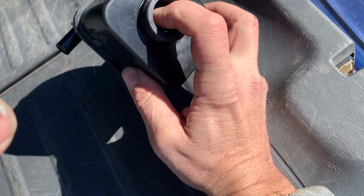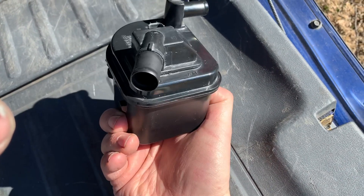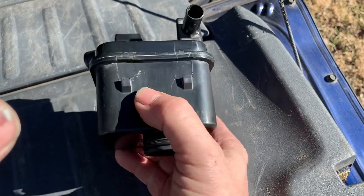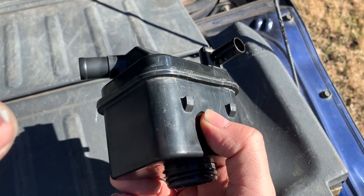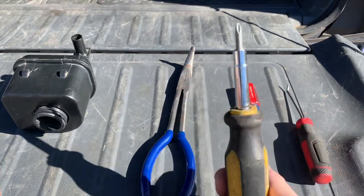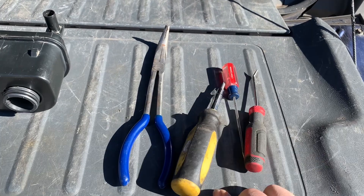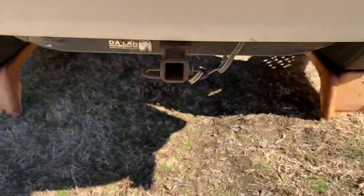Here's what the evap valve looks like — that is the actual valve that should open and close. There's the electrical connection, there's a hose, there's a hose. It hooks into a charcoal canister underneath the car; it's part of your emissions control system. You don't have to pull the entire charcoal canister to replace this. Here's everything we need: a small screwdriver, a slightly bigger screwdriver, and some pliers for the electrical connection.